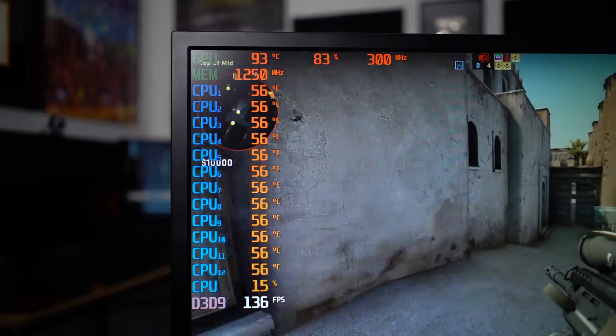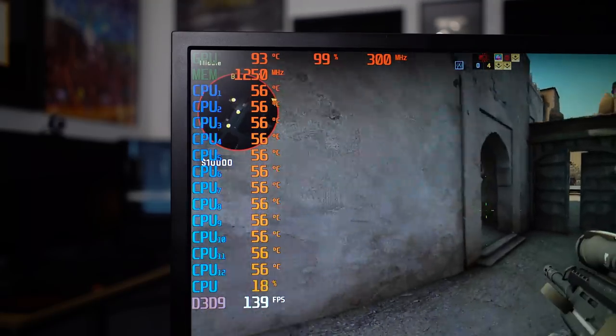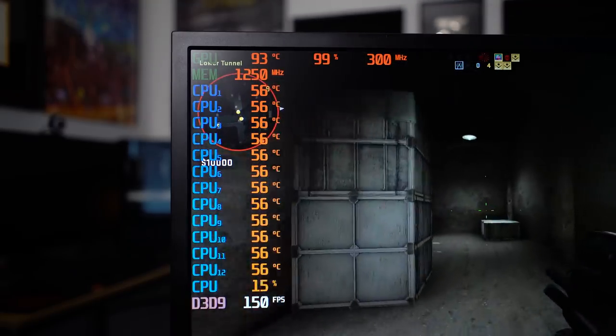Tomorrow. Well, it didn't work, and I'm sure you can figure out why. The graphics card continued to reach 90, 91, 92, 93 degrees Celsius. In fact, with our AMD graphics card, because it couldn't throttle down anymore, the system just shut off whenever it got too hot in an effort to save the graphics card, which is actually a good thing.